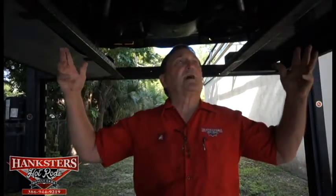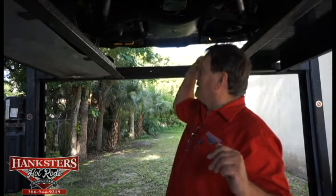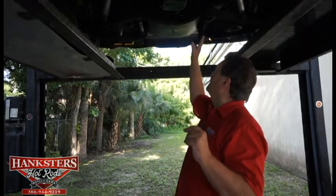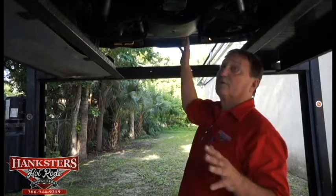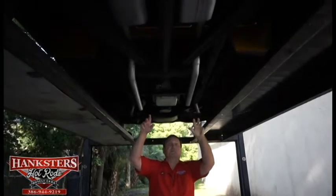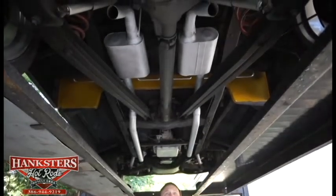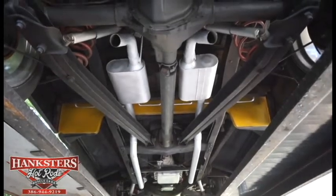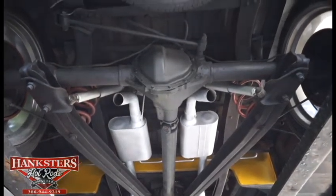We're halfway through it — I don't see anything on the frame, the floor pans, the substructures, the drop-downs, pretty much anything. Engine — everything is new. Forgot to mention, new shocks in the front also, brand new set of shocks. The motor — looking up on it, all the bolts are new. The paint is still fairly fresh on the sides of it, and the pan has a nice fresh coat of paint on it. So it's been a fairly new rebuild on this engine, and it runs and drives the way it looks. Our 2-1/8 pipes transition into two Flowmaster mufflers that are brand spanking new. There's two turn-downs — it doesn't have a complete exhaust exiting the back, but it does exit around the differential area. Also red coil springs in the rear, which leads me to believe they're aftermarket. Two new shocks also in the rear to complement the two in the front.